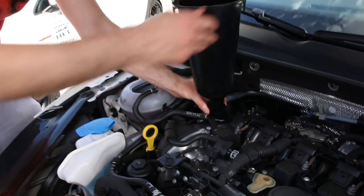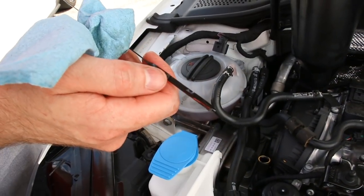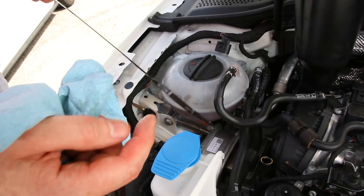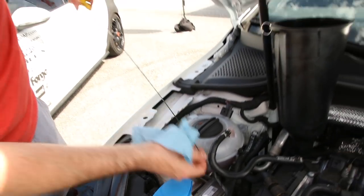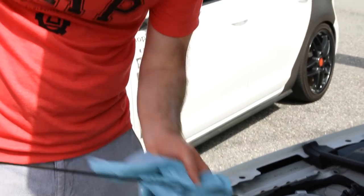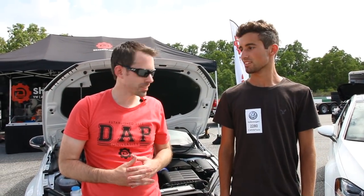We started up, so we're going to lock our filter back in place and then check the oil. Here on the dipstick you can see the checkered part — we want to get up to the top of the checkered part. Based on what I'm seeing we need maybe around half a quart to a little bit more, so we're going to fill that up using about half the bottle we have left, then check it again. And now we're all full, so we are good to go. Thank you so much Kyle for letting us use your vehicle and congrats on the oil extractor and the funnel. Thank you so much for watching our DIY on how to change oil using an oil extractor — remember purchases for parts like this help support videos just like this one. If you liked this video be sure to give it a thumbs up and subscribe.